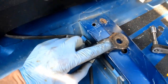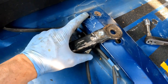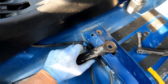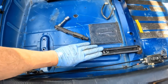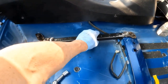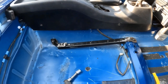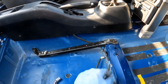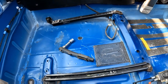I'm going to make that hole there bigger so that bolt sits in it — just like the original one, which gives it a bit more rigidity, more like OEM. So as you can see, the standard rail sits on top. I've just flipped it and put it underneath now. It's rigid. When I weld it, it's going to be even better. I thought it was going to be a bit short, but once that bolt goes through that hole it's even flatter, and welded it'll be really good.